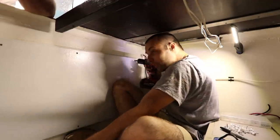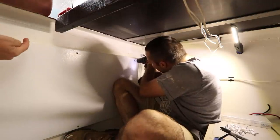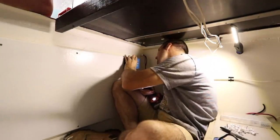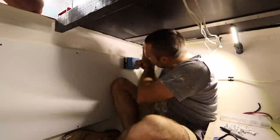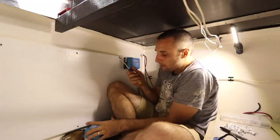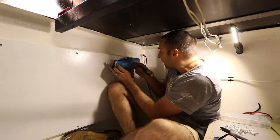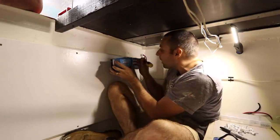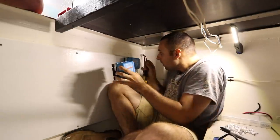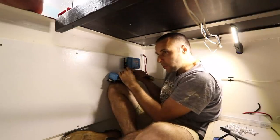Not the most amount of space in the world to work down here. I like keeping them up high too because it lets you access below them quite easily. The NASA battery monitor — they're all pretty much the same, they've all got the same sort of algorithms in them. You just need the shunt with it; that's how they work. I think it's a 200 amp shunt or something — that goes on the negative.